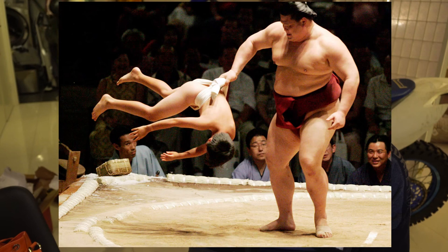What do the parabolic springs do? There are plenty of other videos explaining this, so I'll simply say they're supposed to be thinner where it counts, with allegedly the same if not improved performance compared to regular leaf springs — by way of improved articulation and flexibility. The leaf pack is thinner, and much like sumo wrestlers, the thinner they are the more ground clearance they have. The other advantage is the ability to droop more due to relocation of the rear shock mounts. With the higher ground clearance from the U-bolt plates, the lower shock mount is mounted higher and therefore able to droop further at full extension. So to summarize: low profile U-bolt plates plus heavy duty parabolic springs, all in the effort of making a non-flexy vehicle somewhat flexible.